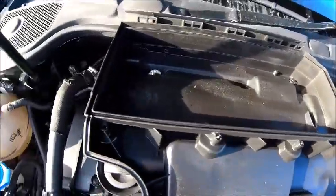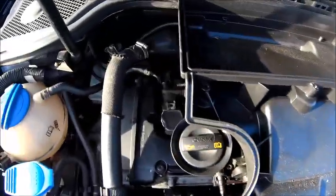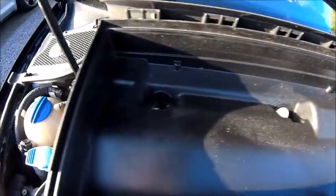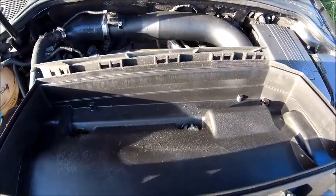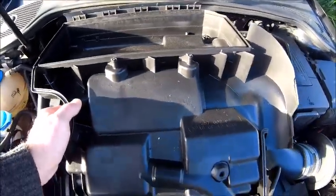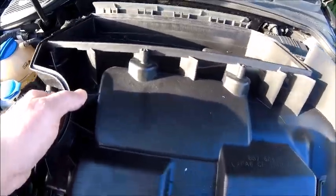So I've taken the bottom bit off and that's where the air filter actually sits. And as you can see, quite a lot is going to have to be chopped out of it. The original assembly went all the way under there, attached at the back and also attaches at the front. But obviously with the pipe in the way I think I've got to lose most of that - certainly all of that. I'm going to take the pipe out anyway, fit the cover in the area where I need to have it, and then look at what I need to chop off to make it fit.